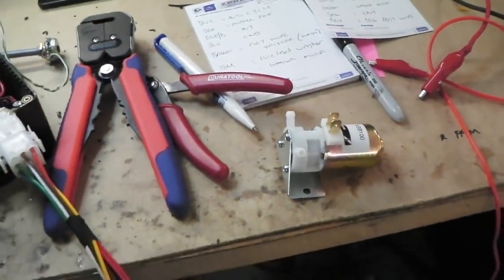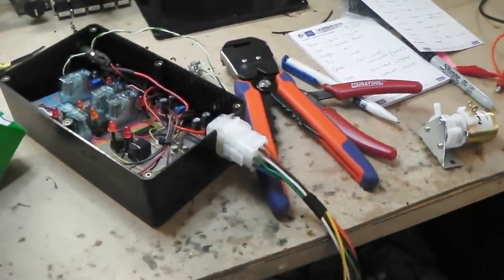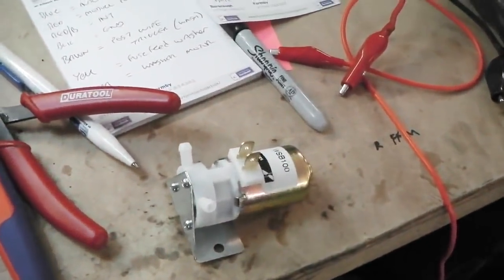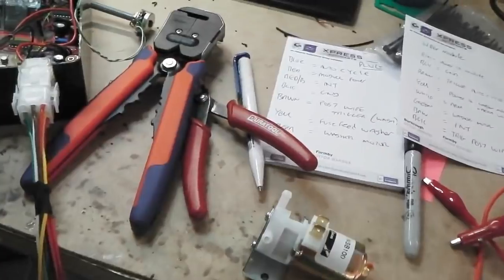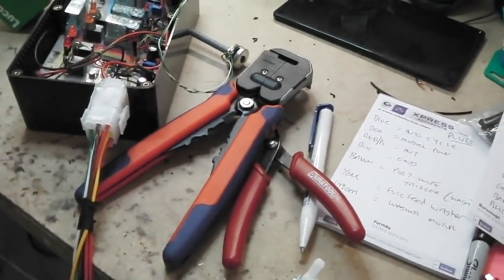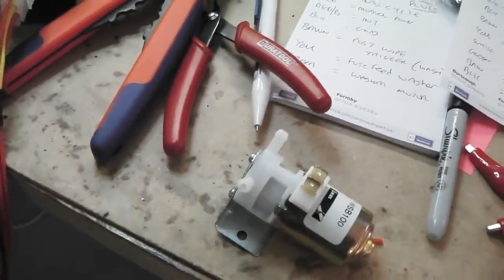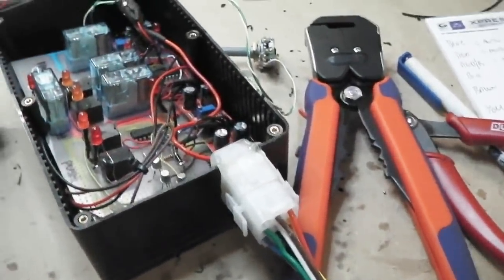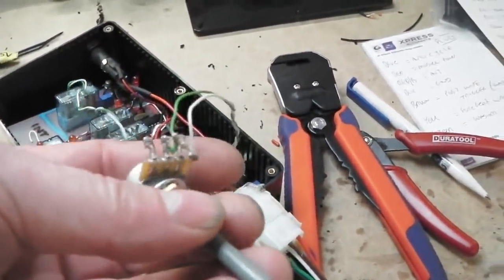self-priming washer, that. So we're going to actually connect that washer up and initiate a cycle on the unit now, and we should get things starting to happen. All we need then to finish the testing of it is the wiper motor itself, but we're going to simulate that with a simple bulb. And then once I'm happy that I've got all the cables correct and the Molex plugs right, we need to add another plug for the intermittent controller.